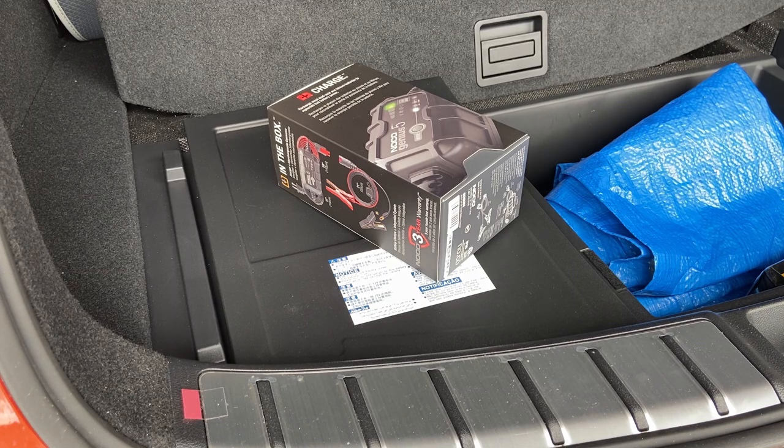So I had to go and use the manual entries and then figured out that the 12 volt battery died. Well, it didn't really die, but it went out of juice. And some of you may say, oh, then that is crappy, right? Definitely crappy. But the reason why is I actually drive very short distances. Even if you had an ICE vehicle or any vehicle, if you only drive less than 1 kilometer after you start your vehicle, over time, it will actually lose charge.